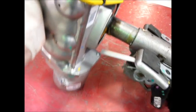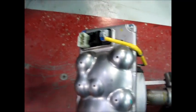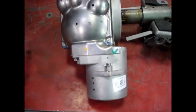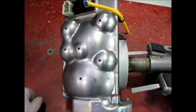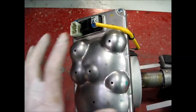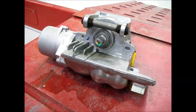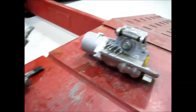On the bottom side here we have a few different things going on. We have our control unit that controls this electronic system, incorporated into this assembly. Also the torque sensor, which is an item that's known to fail fairly regularly, also incorporated into here. On the old power assist unit sitting right there, we actually have a problem with that torque sensor.